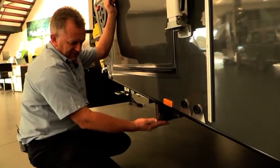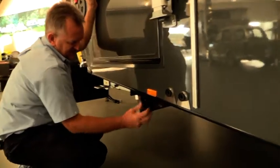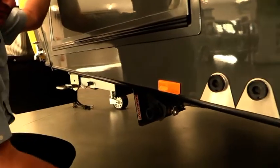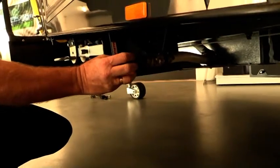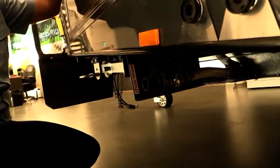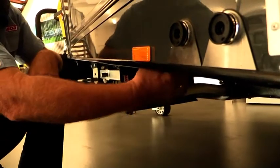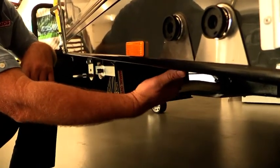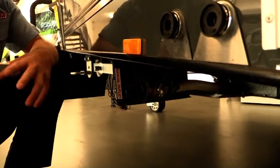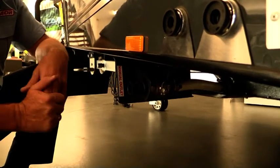This is our manual drain point off our black water tank, or our toilet tank. By taking off the dust cover, I'm then able to hook up our black drain hose onto here and drain that out onto the ground through the hose. Once the hose is connected, I've got a lever up underneath here — I'd pull that towards me — and that gravity feed is allowing anything in the tank to be drained out from that side.